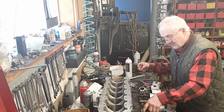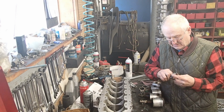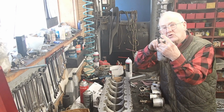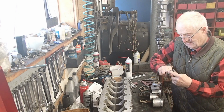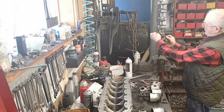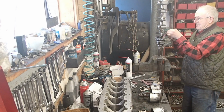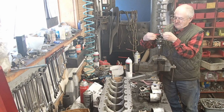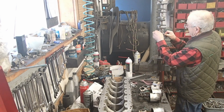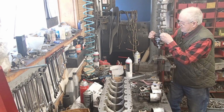Now I'm going to do the inside of the connecting rods, holding it together with my finger, like right here, and pay special attention to the heavy part of the bearing surface, which is right here, and we definitely want it to roll on this surface. I'm going to do a journal, show you how to do that. Now this one, you hold the one pull down and one pull up. That way you're not doing it parallel. And I do it in both directions. And again, the top is the part that wants to get the most attention. That's the top of the bearing. That's where most of the pressure is in this thing. Backside's not quite as important.